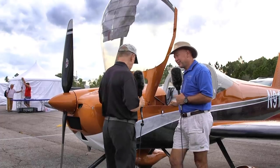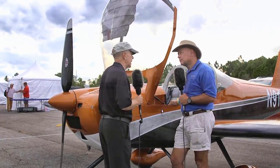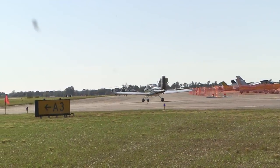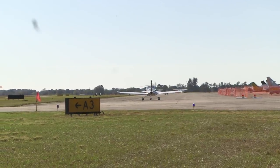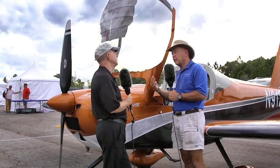Okay. Now you've got to taxi back. So some people go, yeah, but you've got that nose castering wheel. I'm not used to that. And indeed, if you're not used to it, it's a little different. But tell me how that part works. Yeah. So if you're not used to it the first time, it's like, ooh, what's going on here? Because the first thing you'll notice if you've trained in something like a Cessna or a Piper that has the linkage connected to the nose wheel, it's not as stiff in the RV-12 because there is no linkage there.